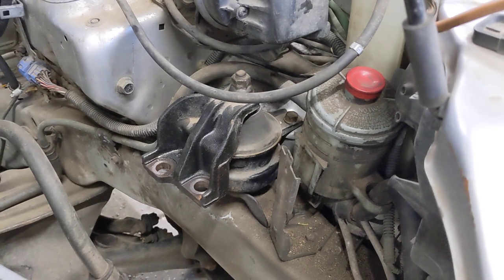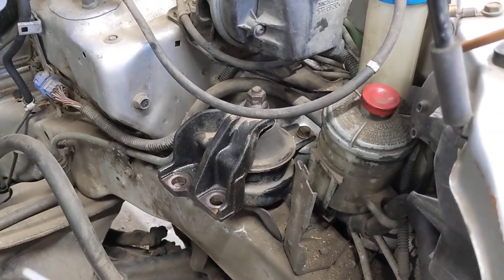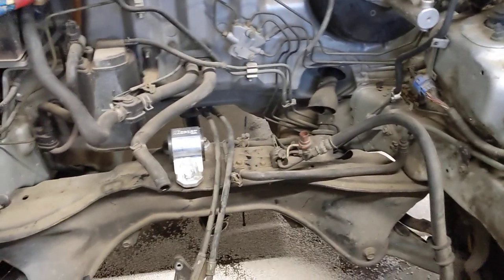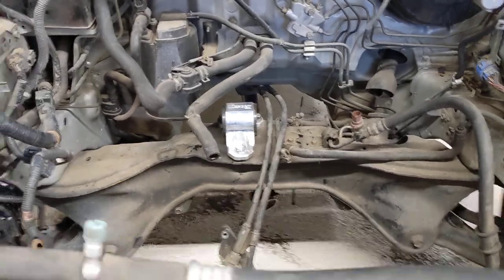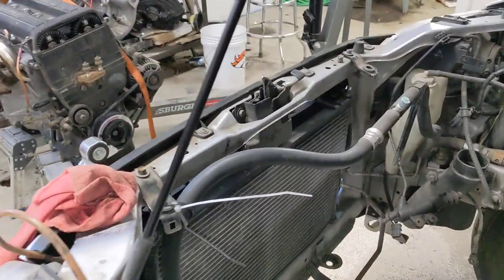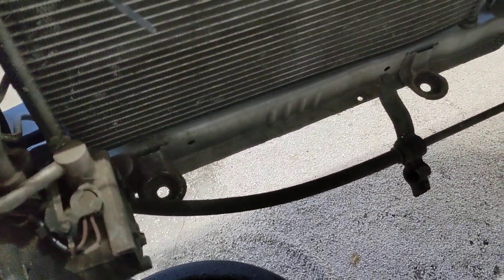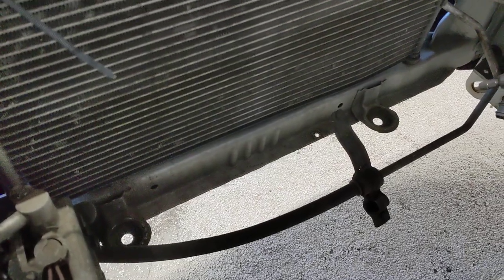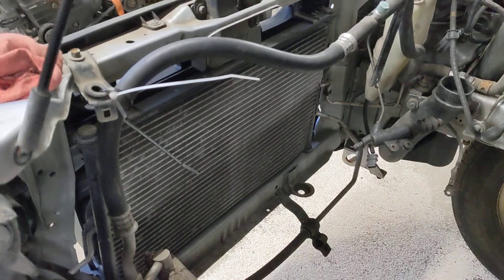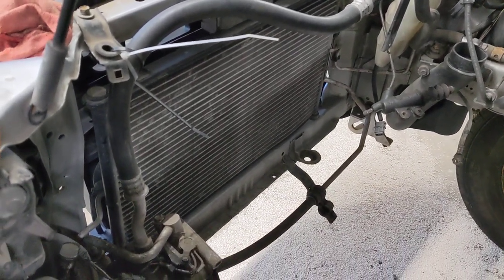However, the new driver's side mount wasn't the right style, and this one wasn't all beat up, so we're going to go ahead and keep that one in there for now just because of time. I need to do the radiator — we're doing a half-size radiator because of the manifold and keeping AC and everything. As you can see, it has the little tabs down there for the full-length radiator. We'll get that put in, measured up, mocked up, and then weld in a new little bracket there.